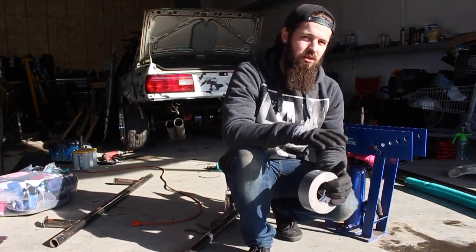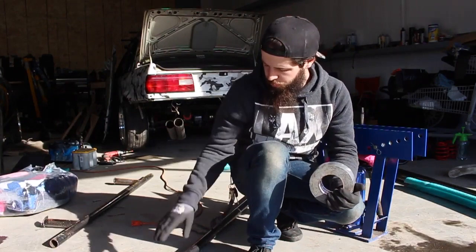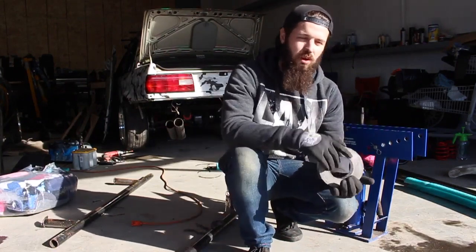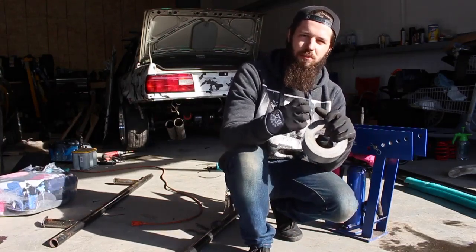If you guys don't know what it is, just do a quick Google search and you'll see 1,000,001 videos. What I'm going to be using is just a roll of tape. I'm going to throw it on the bottom of the pipe, fill the pipe up with either sand, gravel, dirt, whatever I have on hand at the time, put tape on the other end. And then the inside of that pipe is now solid with all that material in it.